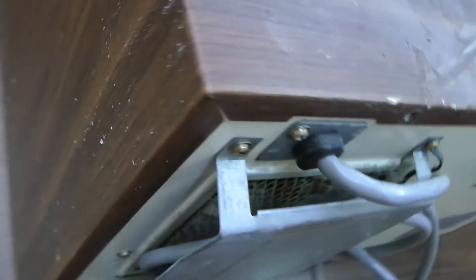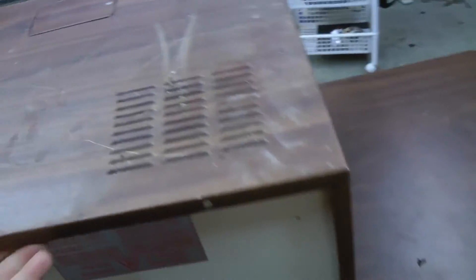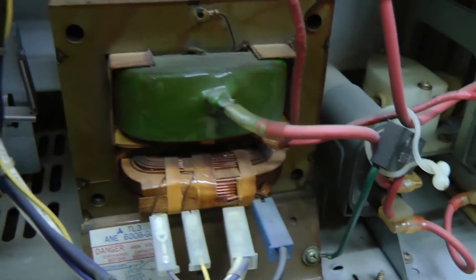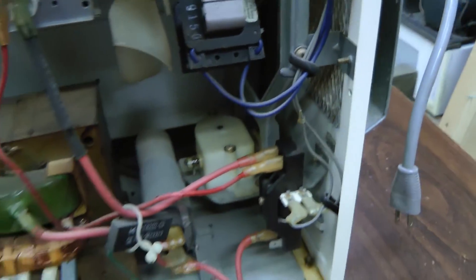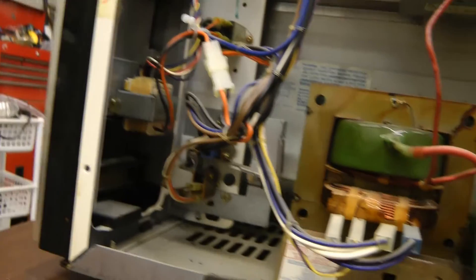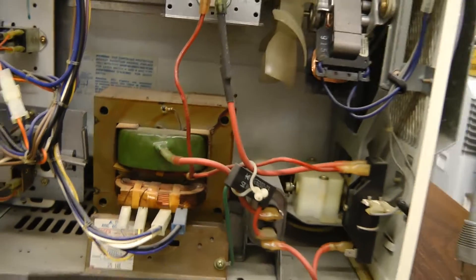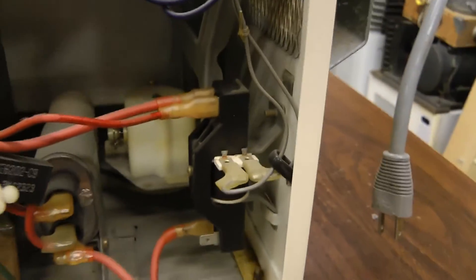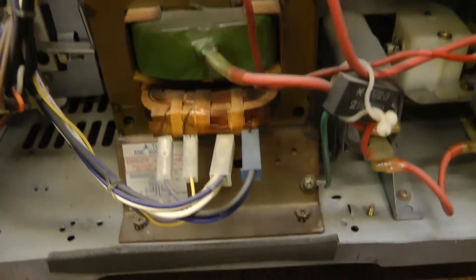While this one's cleaning itself, let's start on the next oven. This one is the Panasonic — not really too spectacular. This one's been used a lot more than all the others based on how dusty it is. Much smaller MOT in this one. The fan motor belt-drives a little gearbox which turns the turntable — no separate motor. This one also has a vacuum relay for power control: there's a reed relay inside a glass tube in the center of the coil, so they can switch on the high voltage side instead of the low voltage.